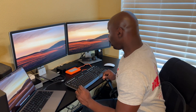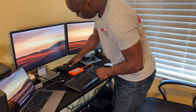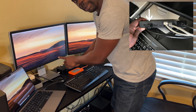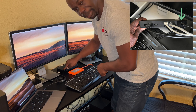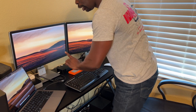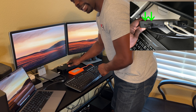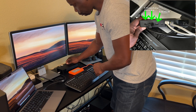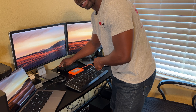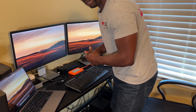In terms of connectivity, this docking station doesn't have that much, so let me go over the configuration. I have a DisplayPort plugged into the docking station, and then to drive the other monitor I had to get a USB-C to DisplayPort adapter and use the Thunderbolt/USB-C connection on the docking station to drive the separate monitor. It does have dual DisplayPorts, but if you put two DisplayPort monitors in there they'll just duplicate — they won't expand. So it's very important that you have one in the DisplayPort or HDMI and one in that USB-C Thunderbolt port — that's the only way the MacBook will actually drive both.